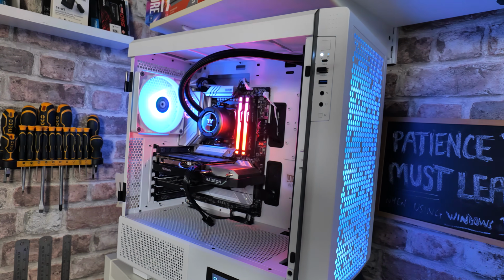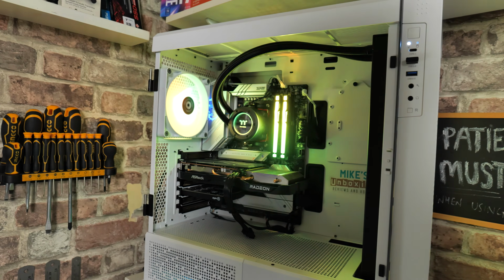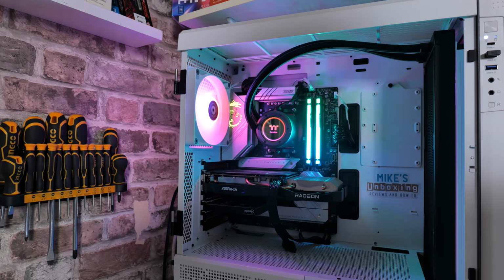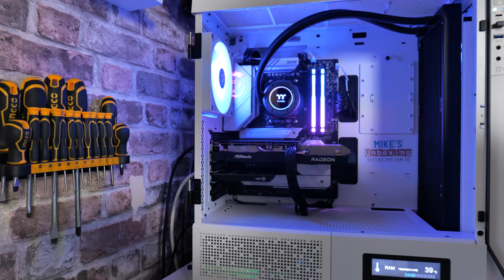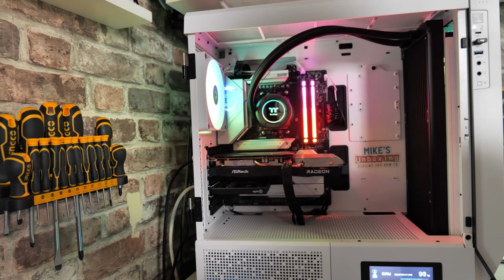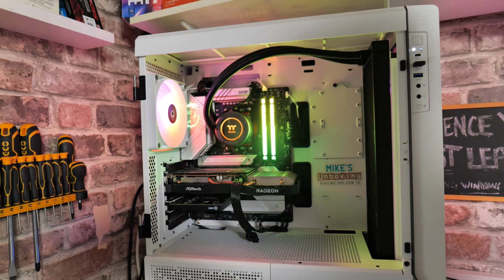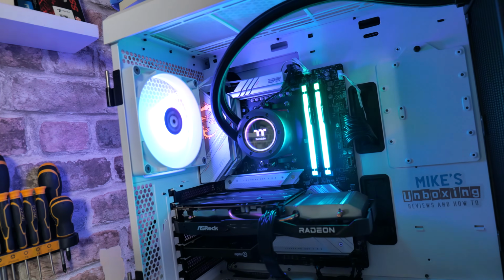And again, like I said, even with the stock settings, if you run it just flat out, let it do whatever it wants with the voltages, just leave the BIOS alone entirely, you still will come in under 95 watts, even though the processor is desperately trying to get to that. But this will prevent it from doing it. Potentially it will do the same for Intel systems as well. I'm yet to test that. I would love to test this on my 13900, but that is doing other things at the moment, so maybe that will be visited in potentially another video.